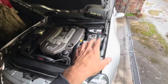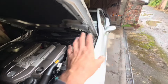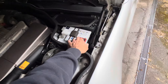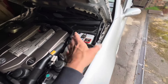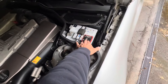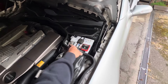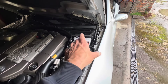For example, our SL55 here has a starter battery in the front and a consumer battery in the rear. When you first start the car the current is drawn from the starter battery, and the alternator only charges that starter battery for something like five minutes. Then the battery control module in the rear switches the full alternator charge to the consumer battery. So if this car had been running a little while you might only find 12.6 volts across the battery, and it would be wrong to conclude there was a problem with the alternator.